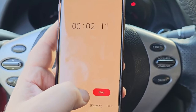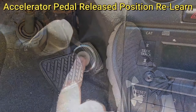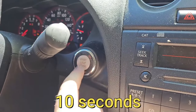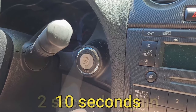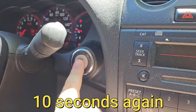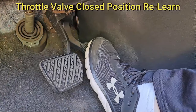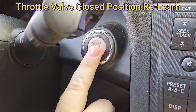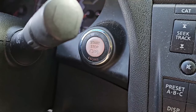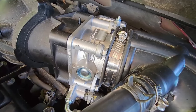It's better to use a stopwatch but you can count manually. Make sure the gas pedal is fully released. Turn the ignition switch on and wait at least two seconds, then turn it off and wait at least 10 seconds. Repeat that cycle once more. For the next step, make sure the gas pedal is fully released, turn the ignition switch on, then immediately turn it back off and wait at least 10 seconds — at which point you should hear the throttle body make a clicking noise.